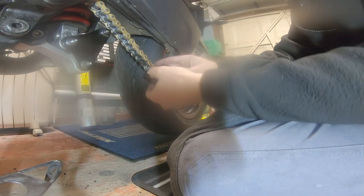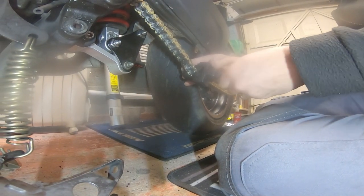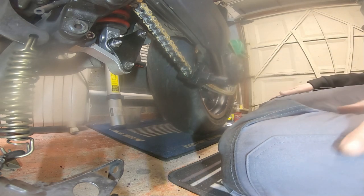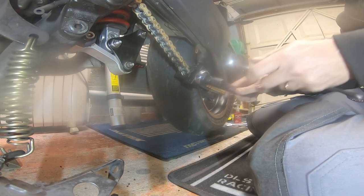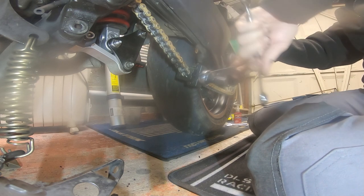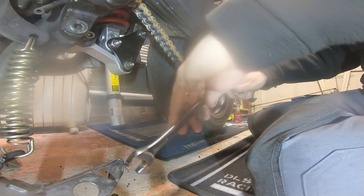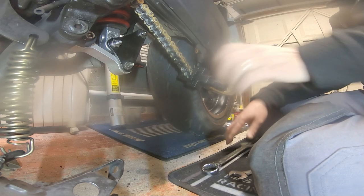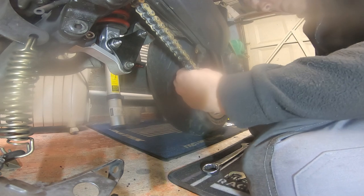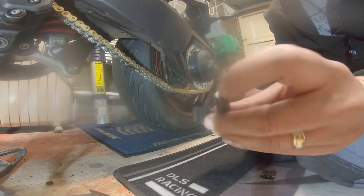It's really important to get this in the right position — and it's not right now. You can feel it because the back sort of hooks over the two rivets, and the front also hooks over the two rivet locations. That feels right. Now we need our big spanners — the 27 and 19 — and we just start tightening this up, not too much at first. Now we'll back it off and check. So far that looks all right to me.